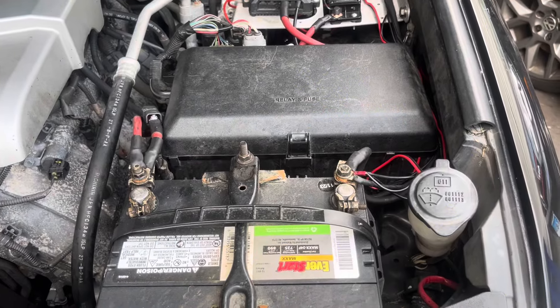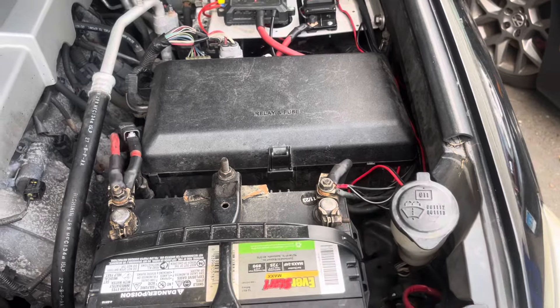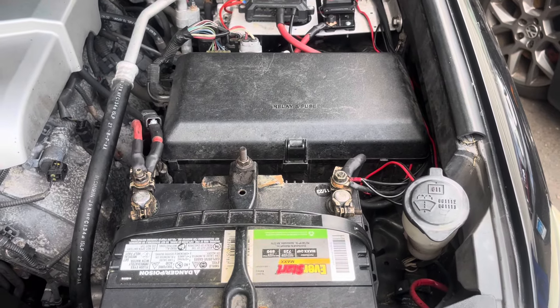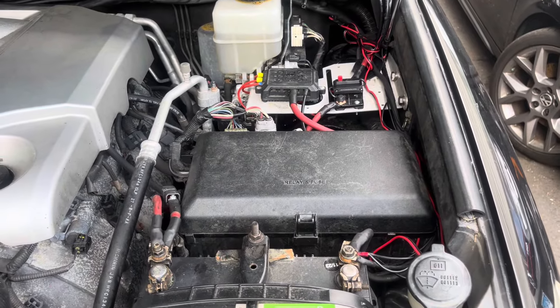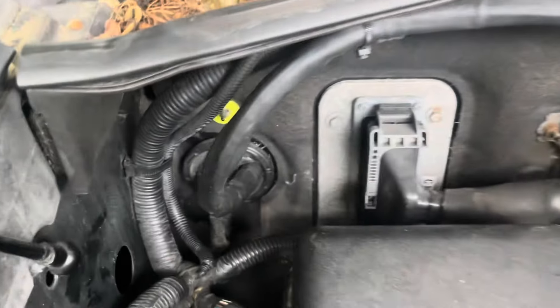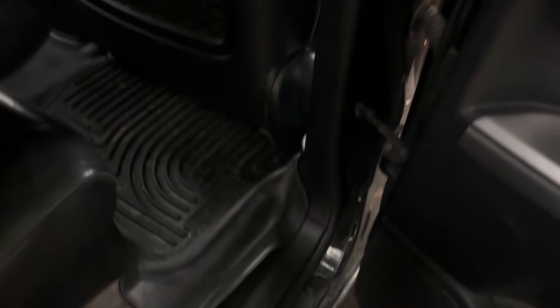To charge the battery in the back, I ran two hot and ground cables all the way to the rear of the car, through a 50-amp breaker using four-AWG wire — plenty for 25 feet. It runs across the back, through the firewall, everything wrapped with heat shrink tubing, which was quite the chore. Then it came through the kick panel, around the pillar, and to the back.